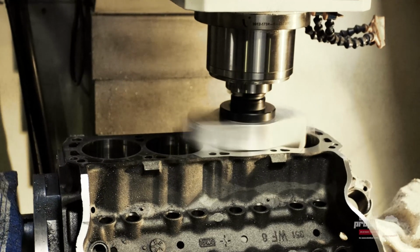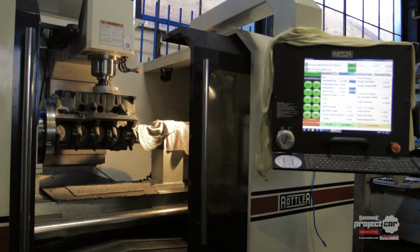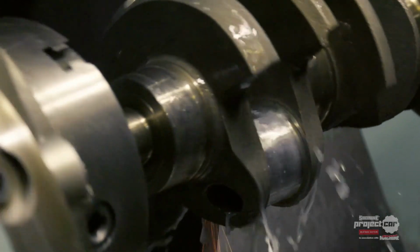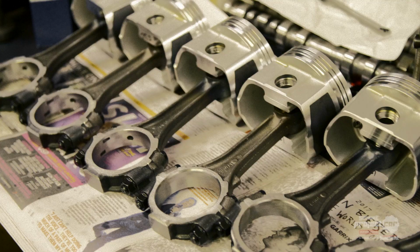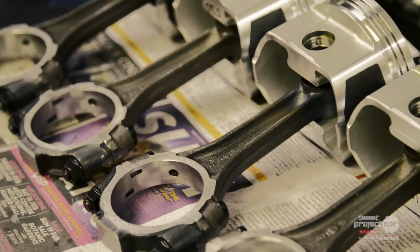And what are we retaining from that engine that came with the car originally? Not a lot really, mainly the block obviously and the crankshaft and the conrods. That's about it. So pistons, are we going to go for forged or cast? So we've ended up with a forged piston, which makes me sleep better at night. Yep. Knowing we've built it nice.